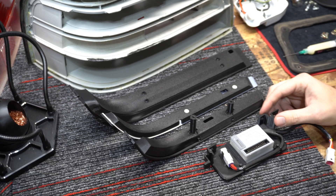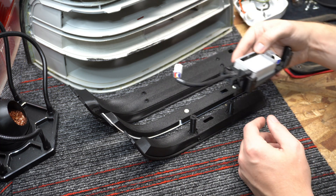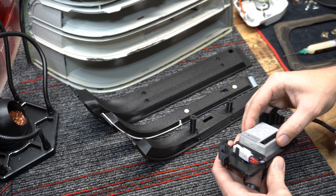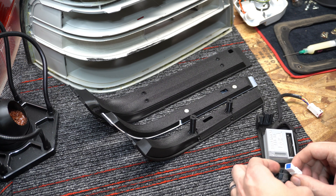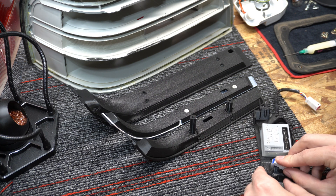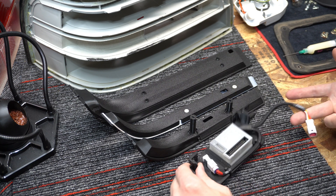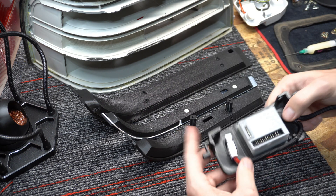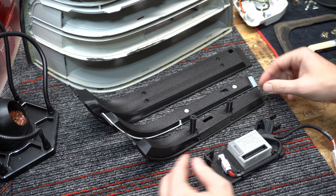So this is everything I've ended up with. I have this little plate that basically slides in the back of the tail light, and this is where I've mounted my ghost module and pigtails. I made a little clip here that is where all the wiring will go in for the 12 volt out to the LEDs, and then the ribbon cable will come in, plug in there, and then this is for the vehicle inputs, which I labeled on there.